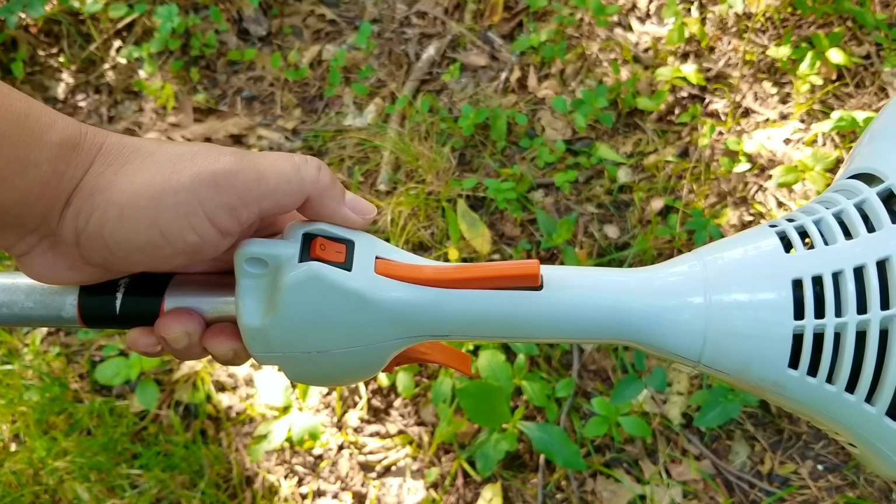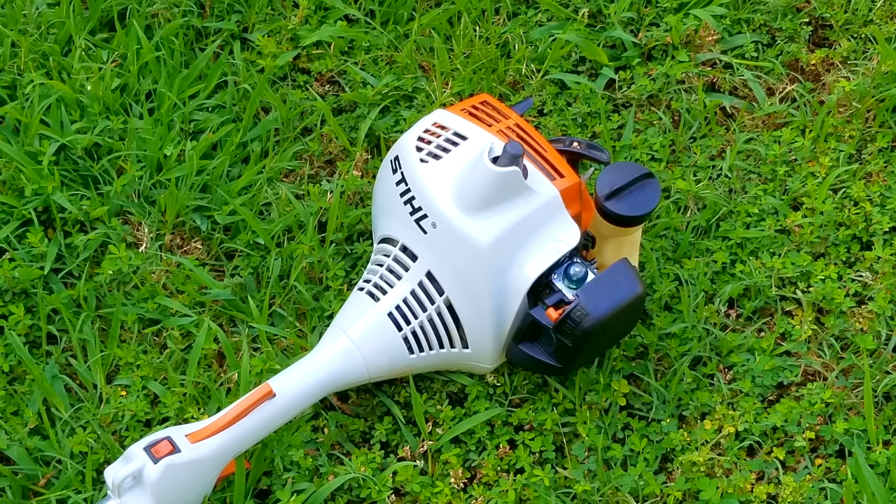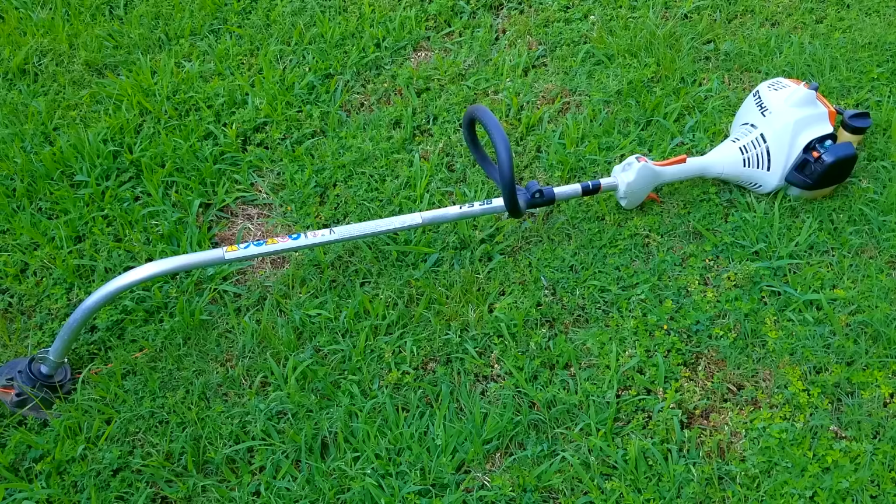I hope you could hear the difference between the before and after shots. The throttle response was much better, and of course the engine speed was much higher than before we cleared the exhaust. Another reason why the engine wasn't performing like it should have could have been as simple as the trimmer string putting too much load on the engine.